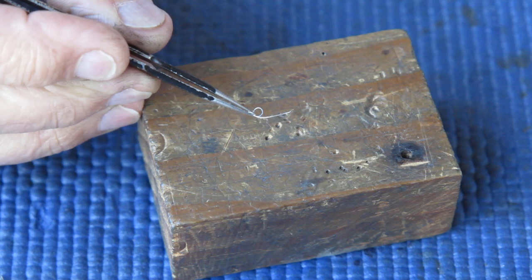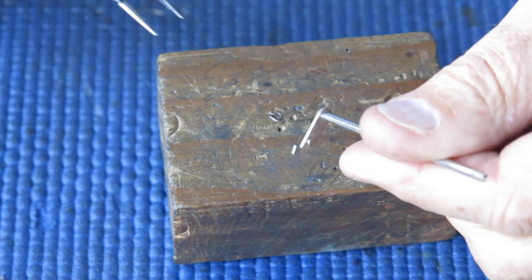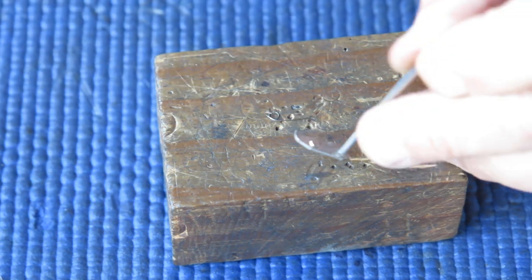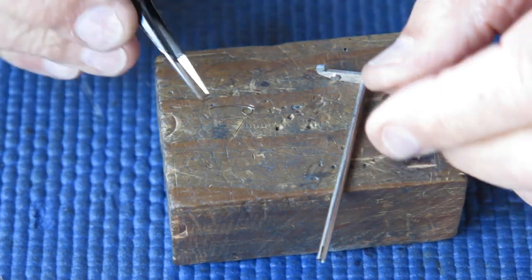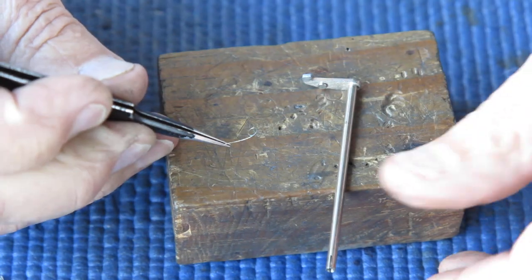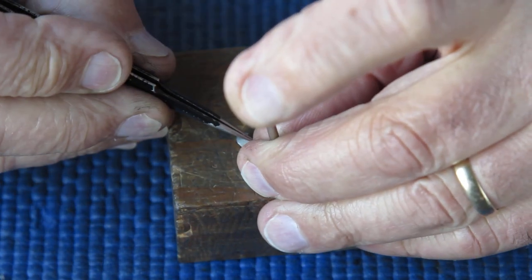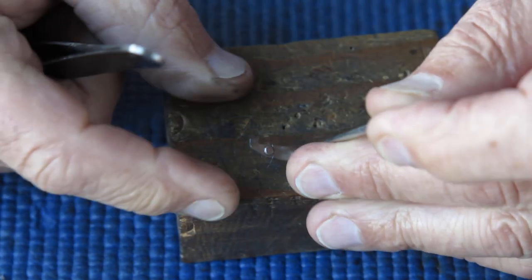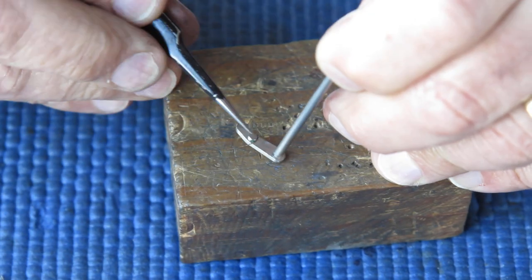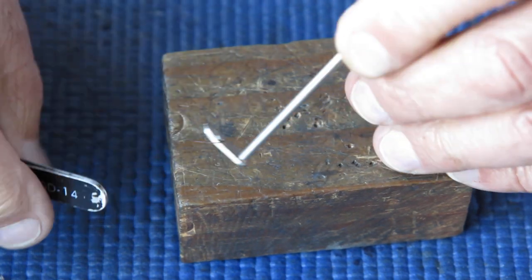Well, this spring here is the return spring for the release lever, and it has to fit over this boss here. So it's always a bit of an act to get it in place. I take them off while I'm cleaning components because otherwise it's prone to get lost. That one went on without much of a fight, which is a bonus. Must make sure that this spring lies nice and flat, otherwise it'll tend to want to work its way off.